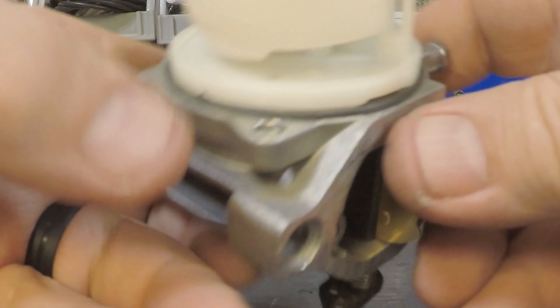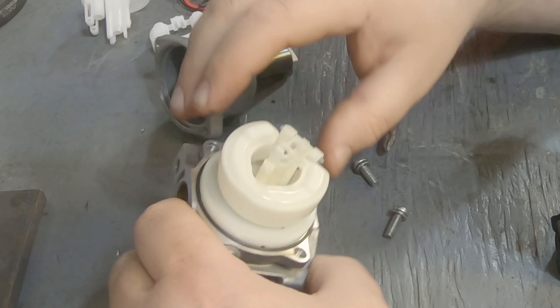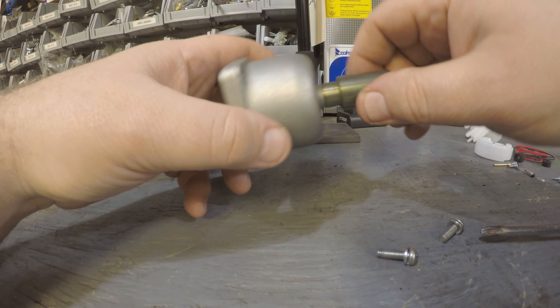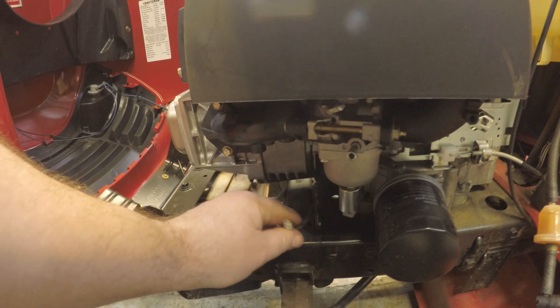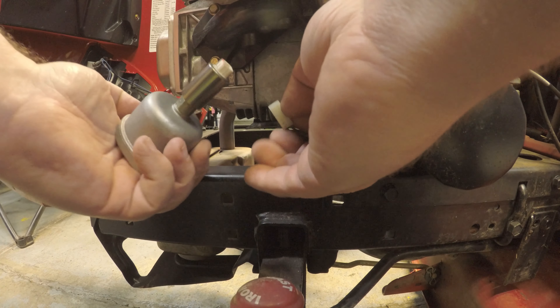Get that lined up, keep it upright, and push it straight up on there. The gasket should be visible all the way around the outside because your bowl seals on that. Before I put the bowl back on, I'm going to show you a quick way to test the solenoid. Take it over to your mower — if you watched the other video, I've already got a replacement carburetor on this one, so I'm rebuilding this one for another mower — unplug the plug and plug it back in.